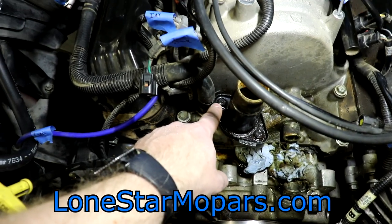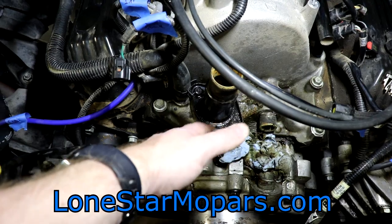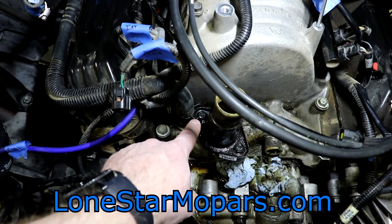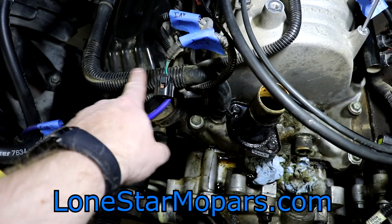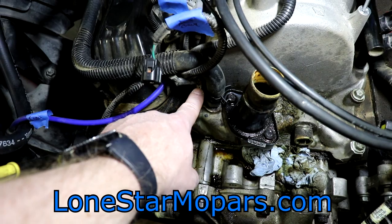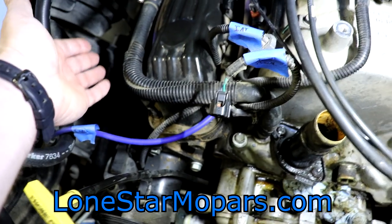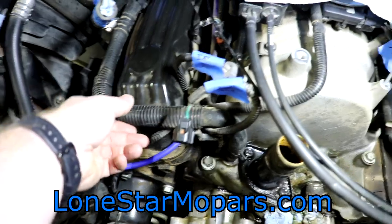First thing I want to point out is right here — this is our heater hose. It's going to come off right beside the thermostat housing, which I'm afraid we may break those bolts off. The good news is we're pulling the motor. In a normal situation, if you're just replacing the thermostat and you break off at this point, that would not be good — you'd probably be pulling your intake. That said, it is a simple clip, but the way it's oriented it's very difficult to get in there. It completely traverses into this convoluted tubing. Right here — where I don't have a label because there's no space — is our coolant temperature sensor. The heater hose enters the convoluted tubing, presumably to protect from heat from the valve cover.